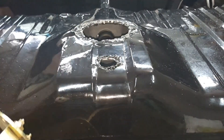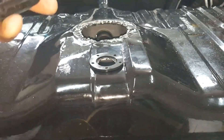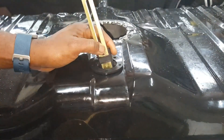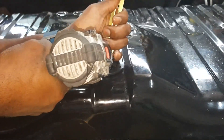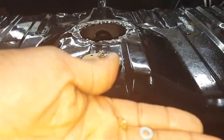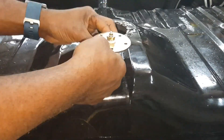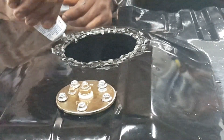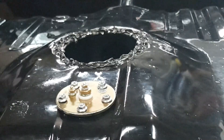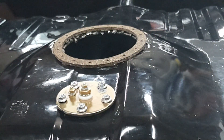This is a very important part — I have to lock everything in, bolt everything in, so I'm putting down the gasket. I have to do the fuel sending unit first because I have to get through the larger hole so I can assemble the fuel sending unit together first. My biggest concern about this whole project was making sure I got the surface level right. I don't think it has to be that deep because this is thin sheet metal — the platform the bracket sits on is gonna bring the sheet metal to level. That's me assembling the fuel sender unit and then the fuel pump.